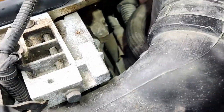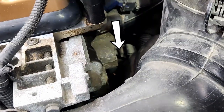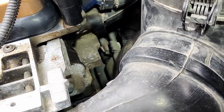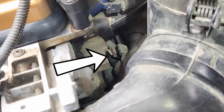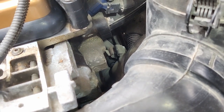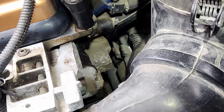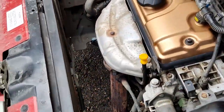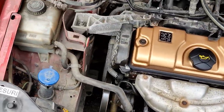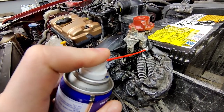And then the starter motor, the solenoid, you can see that there's the solenoid's plus and the red one, and under it is the minus one. And as you can see, the minus one is a lot blacker than the surroundings, like it doesn't have any dust on top of it. And I believe that goes from the starter to the solenoid. So it's like 2 centimeters of ground cable. So yeah. But for now I'm just gonna oil all of these.